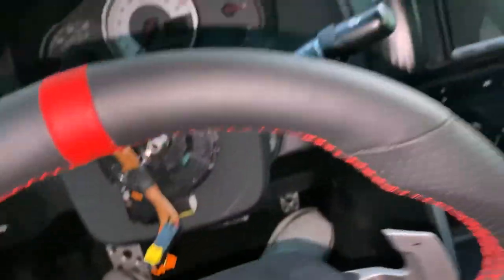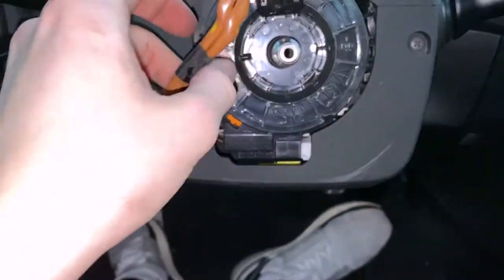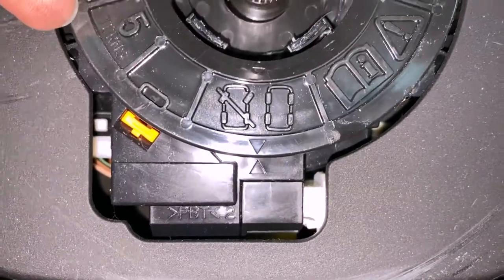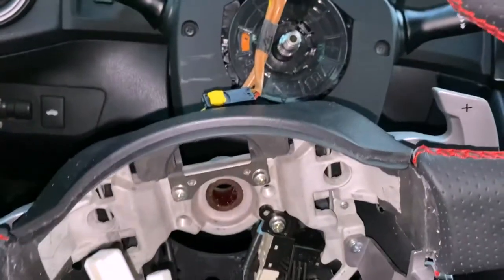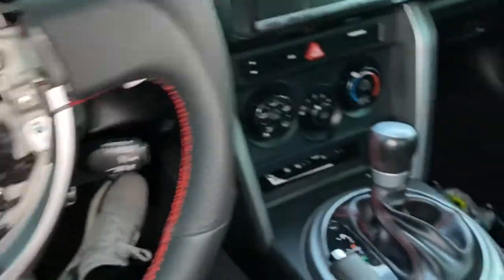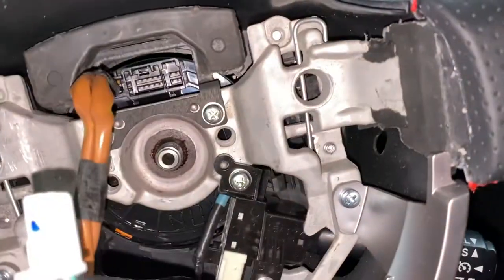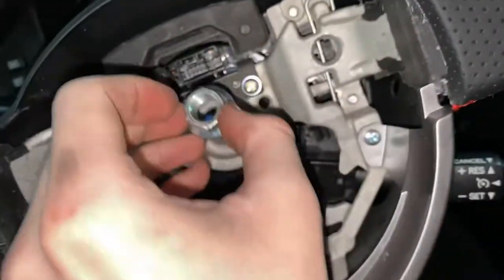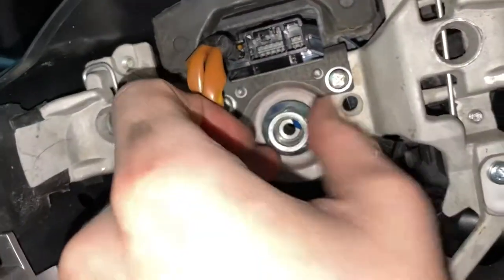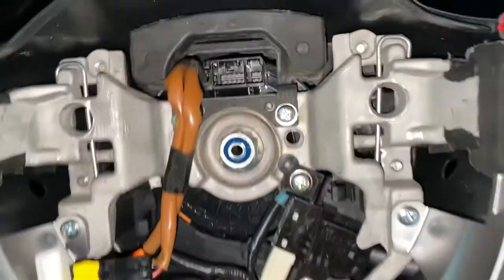Now that we are back in the FRS — the wheel was a little bit cockeyed so I might need to get an alignment. You can see those two line up perfectly for top dead center, and that goes right there, so I just need to fit these back in here. I want to add some blue medium-strength thread locker to that bolt before I tighten it, so I'm gonna grab that first. Alright, a little bit on there — we're gonna go back in and stick that right on. Wheel is in place.